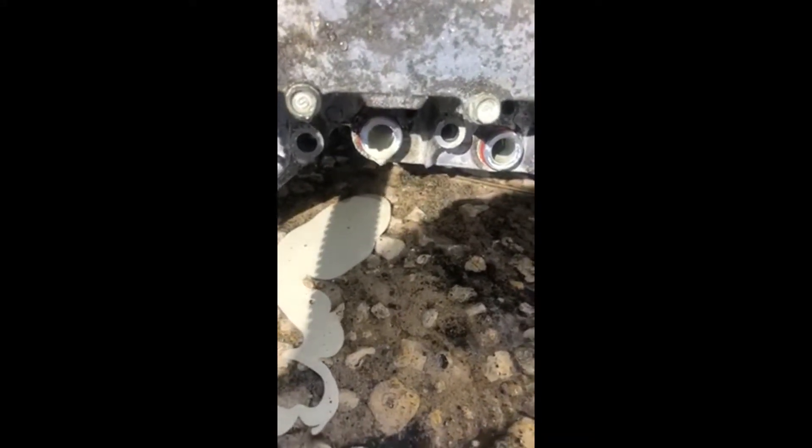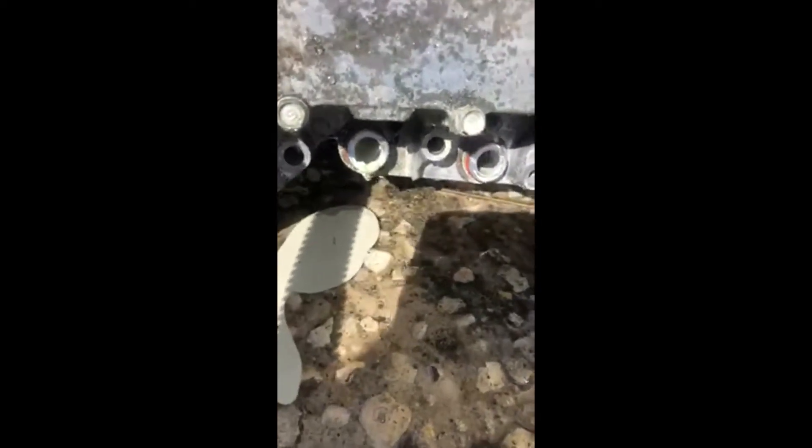If the oil draining out increases with the water pressure, then the gasket is leaking inside and needs to be torn apart and rebuilt as well. That's how you check — just put the jumper hoses on the side, hook up your water hose, pressurize it, and wait to see if the flow turns clear and speeds up.